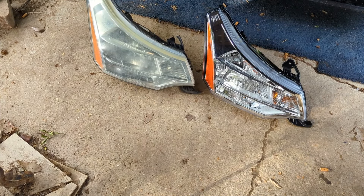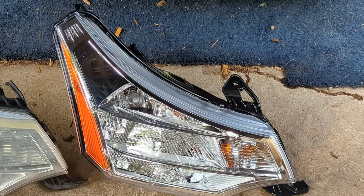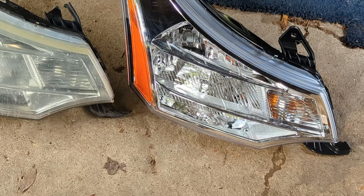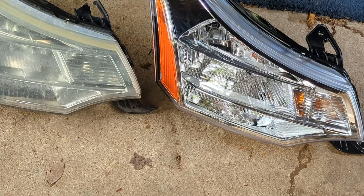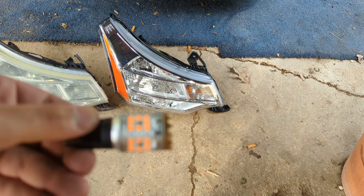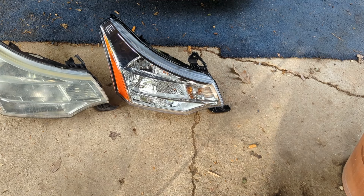Here's the driver's side new headlight lens — you can see the difference is night and day. It is absolutely unreal. The new lenses actually have bulbs pre-installed, and for $155 for the pair including shipping and tax, I'm so happy. For the turn signals, I've got these from a company called Last Fit — pure amber LED non-switchback bulbs going right in the turn signal slash DRL slots. I've already confirmed they work with no hyper-flashing. Let's get these installed before I have a stroke.